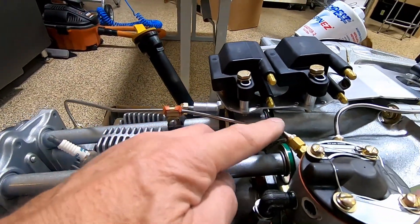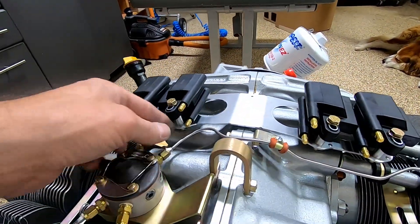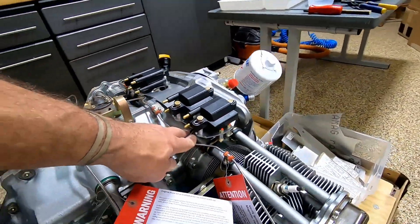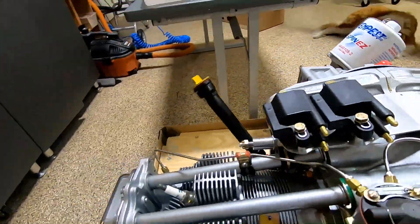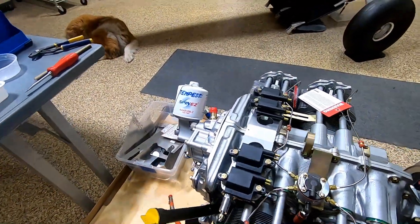I also bent this down — this one was going straight into the coil pack, but I put all the plugs on and they don't even come close now, so I feel pretty confident that's going to work. There's no tension on it. Got these little guys in, put some torque seal on it, and that will conclude tonight's project. Buenas noches.